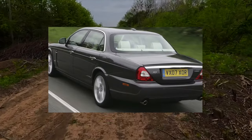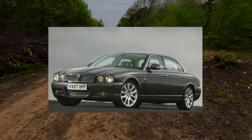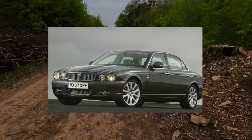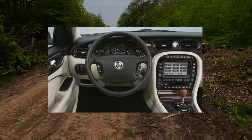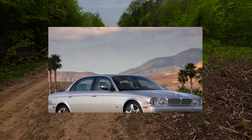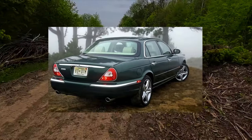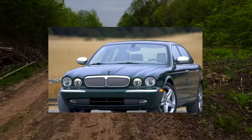Three liters is a very good choice in every sense. The AJ-30 series is the closest relative of the Ford/Mazda V6 2.5 to 3.0, but with some important differences that make them, by and large, not interchangeable. The AJ-30 has phased shifters on the intake shaft, no hydraulic lifters, and a proprietary cylinder head, a very special intake manifold and attachment.